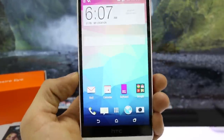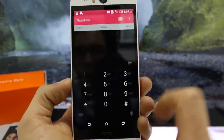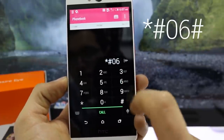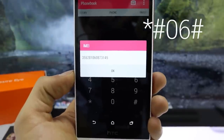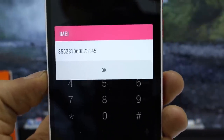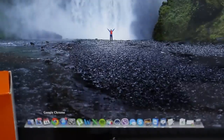So we're going to start by opening the phone application just as if you were dialing a call, and you're going to type the following command: star hash 06 hash. Your 15-digit IMEI number will appear. This is a very important number and based on this number we're going to request the unlock code. Just make sure you keep it somewhere close or write it down because we're going to need it later.